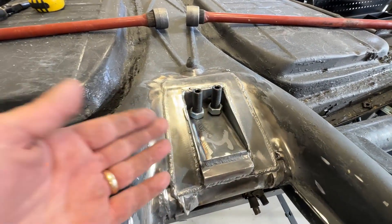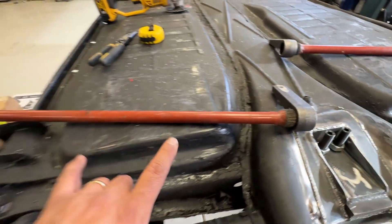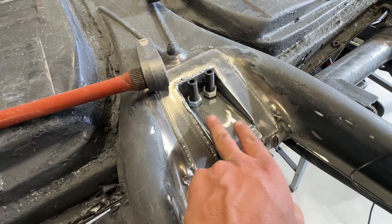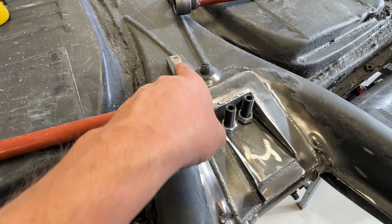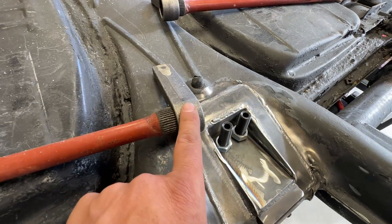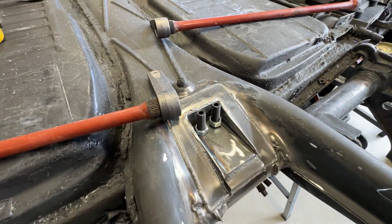If it's too far down, it starts to interfere with the shifting mechanism. Another lesson learned: these are the torsion springs that are going to go on there. This piece right here will be put inside here, feeding this spline into this arm. These screws push down and that adjusts the height of the suspension. What I learned is you want to heat these up really hot such that they slide in easily. If they're the same temperature, it's a really hard fit, but if you heat these up, they'll slide right in.